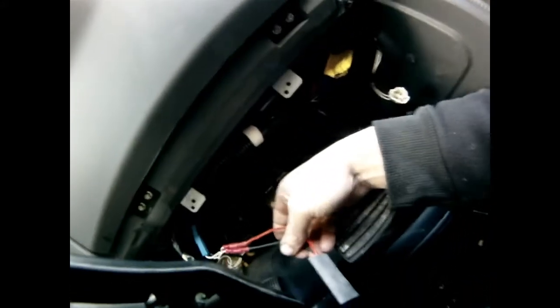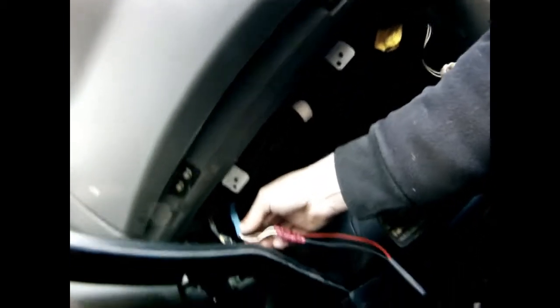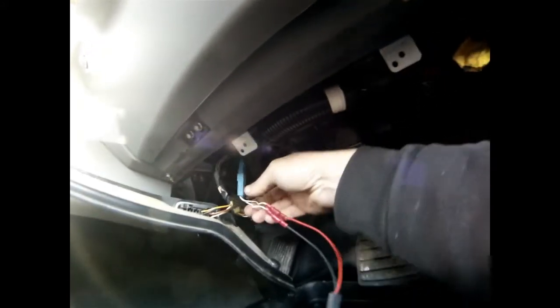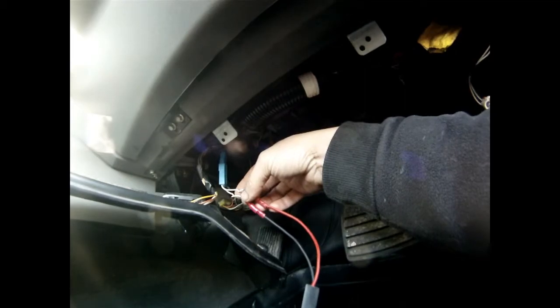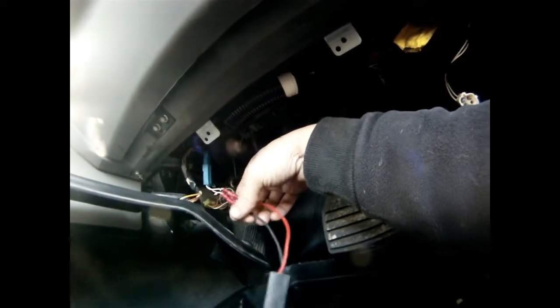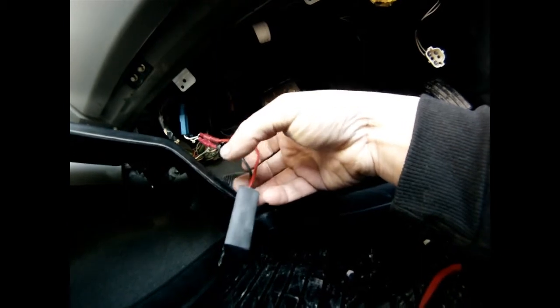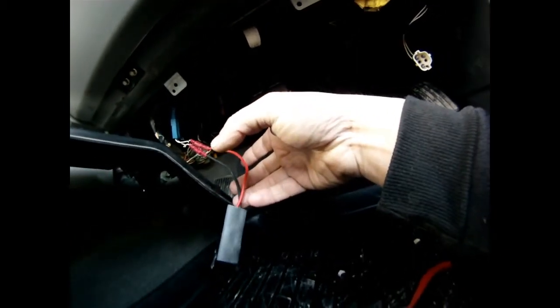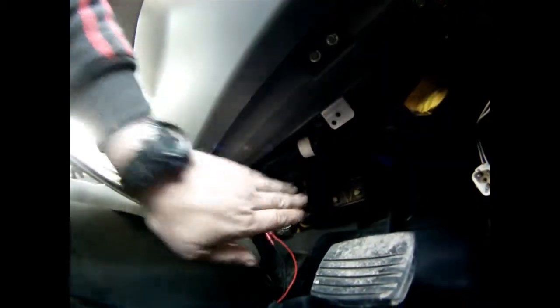You'll find this little plug over here — this is the red one I've put in. All I've done is removed the existing plug, simply chopped into the white one that was there for the catalytic converters, made my own little plugs up, and inside there is a 180 ohm resistor. It is that simple to do. A lot of people get a bit worried about electronics on these Land Rovers, but it's not that difficult.